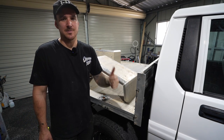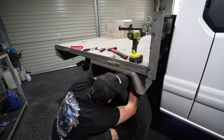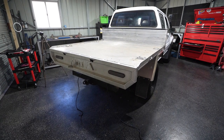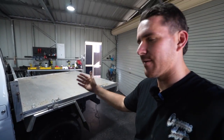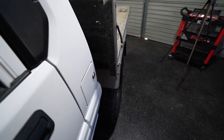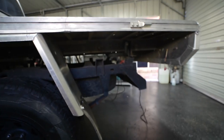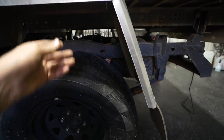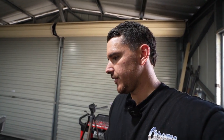The tray is finally mounted and it looks bloody awesome. The mud guards are on too. The tray is a little skinnier so the wheels don't poke, which is a bit of a shame. For the mud guard mounting I used existing brackets bolted through a hole and drilled one additional hole, then tech-screwed the mud guard up from the bottom. The gap between tray and wheel arch is nice and parallel, meaning the tray is sitting level - absolutely stoked with how it looks.